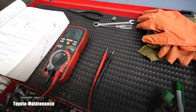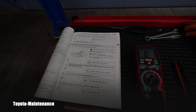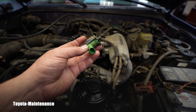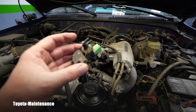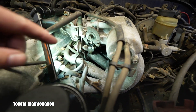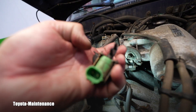My measurement was 258 kilo-ohms when I was touching those two pins. That means the EGR gas temperature sensor is okay. The very next step is this component — called a VSV in the manual.